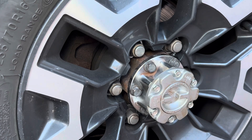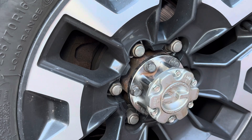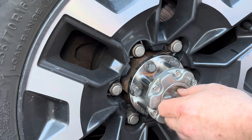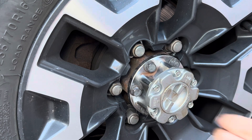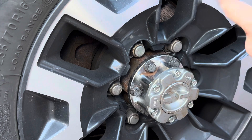Free wheel — so we won't turn the CV and the differential — and then lock. Leave it on lock in the winter, and in the summer just drive around free. Start your four-wheeling weekend, just go to lock and leave it. It'll help reduce some wear and tear on the drivetrain and get a little better fuel economy, not having all the wheel engaged to the CV going through the differential.